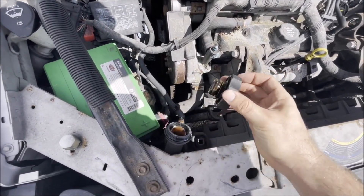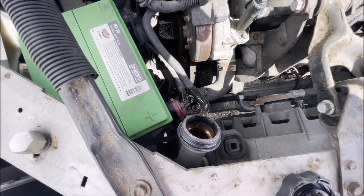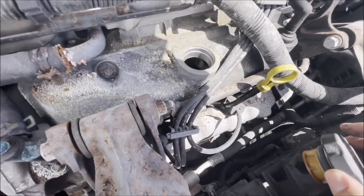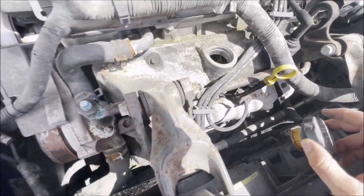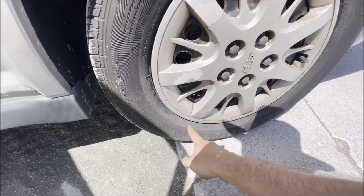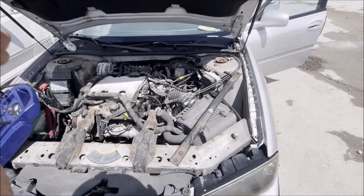This is typical old Dex-Cool - I wouldn't say that's indicative of a cooling system issue, it probably looks like the original from 2004. The engine looks really clean inside - all I see is nice clean golden oil. How are our tires? Dry rotted, I can already see that. Date code is '08 - yeah, these are due for replacing. That definitely vindicates the low mileage. Got the booster pack on it, let's see what she does.